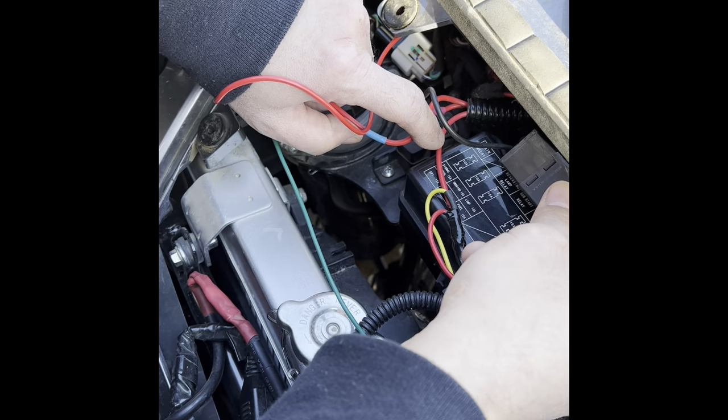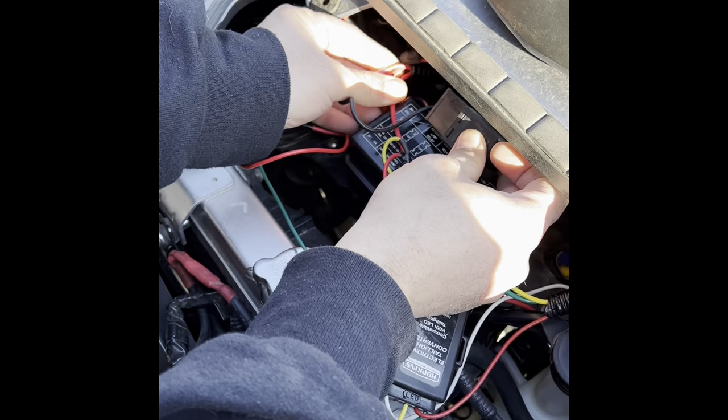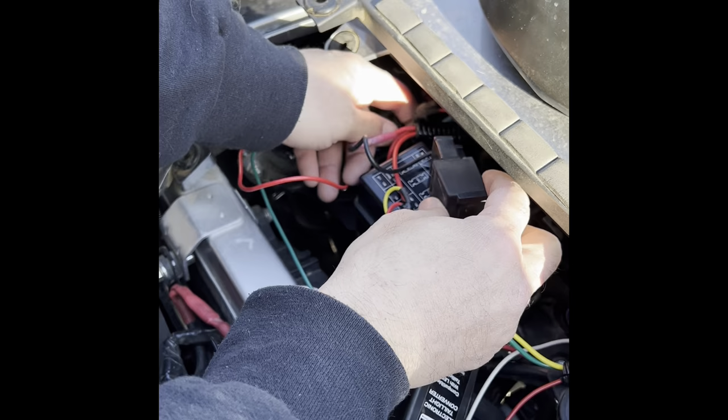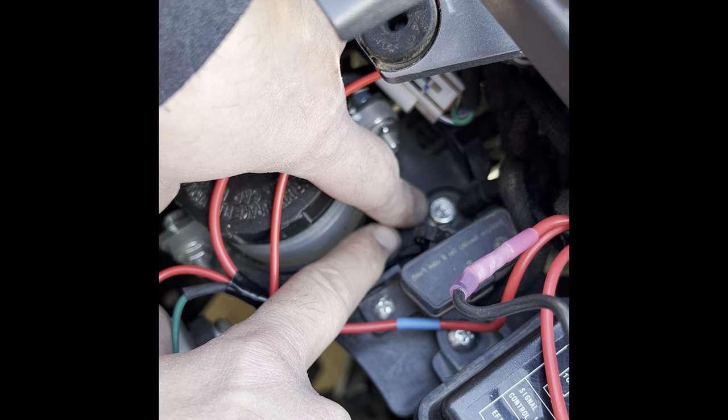So there'll be three wires coming off of the switch that we're going to mount, and there'll actually be four wires, because you'll have the right turn signal, left turn signal, you'll have a beep, and a load, and then there'll be a ground coming out to light up that specific rocker I have. And I grounded that right here on this side, in the same spot, opposite side, I grounded it.